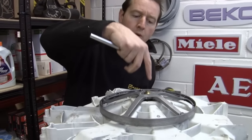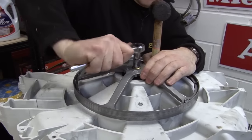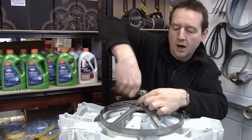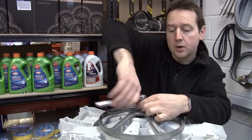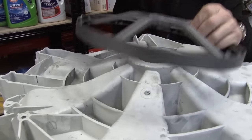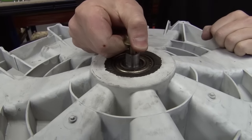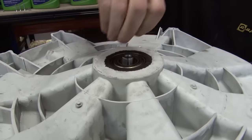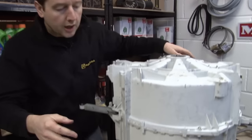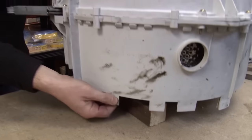Let's remove the pulley wheel — it's just bolted through onto the main spindle. It's just a 13mm socket. On this one I can feel the drum dropping through as I undo that bolt. If your bearings have completely seized, you might need to just knock that through so that it's loosened up. Now I've rested the whole thing on a couple of bits of wood so the weight's not on these outside bits of plastic that could snap off.